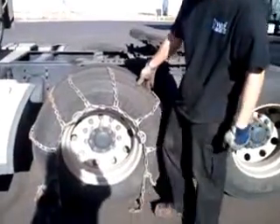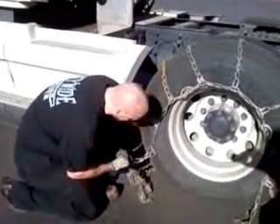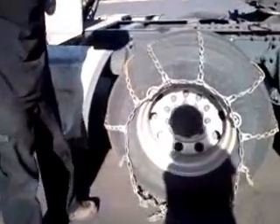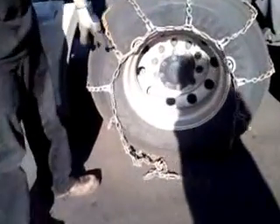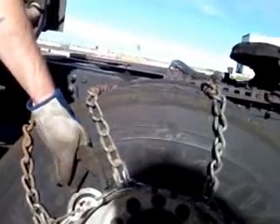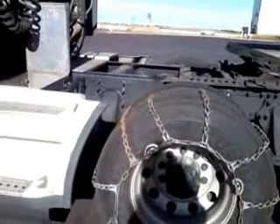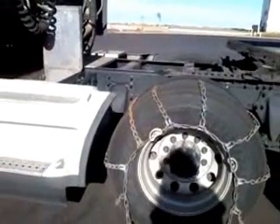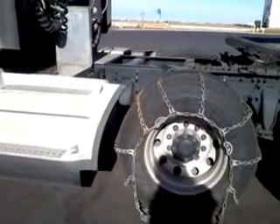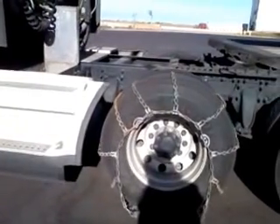So that it touches the ground on one side, and you've got a big pile on the other side. You want to pile it up on each side of the tire like that. Make sure all your locks are on the outside, and all the teeth are on the outside, so they don't cut into the tire. I'm going to move the truck forward a little bit.